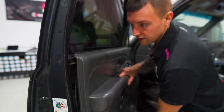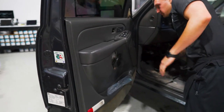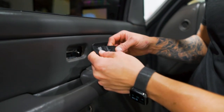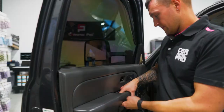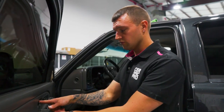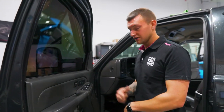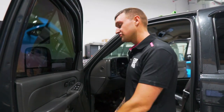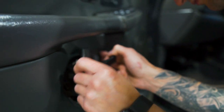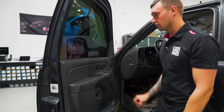Front door: gasket back in place — there's new residue here, take that off. Door panel up against the door and down, make sure all the parts are clicked in. I like to put this front top triangle in first, pop it into place. We have this bracket that's supposed to be screwed in somewhere else but it wasn't, so I'm going to have to check the other side to see how this piece is lined up. Otherwise you'll put the screw back in, pop this piece back on front end first. Make sure you put that screw back on when you reinstall this cover — hook the front end first, long screw goes down here, and then the one other screw which I'll take care of later.